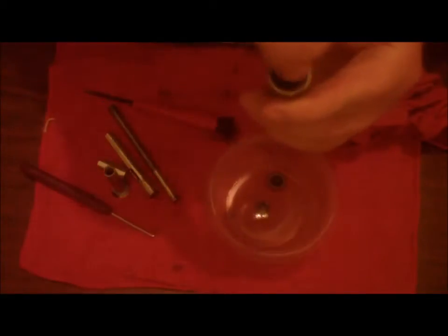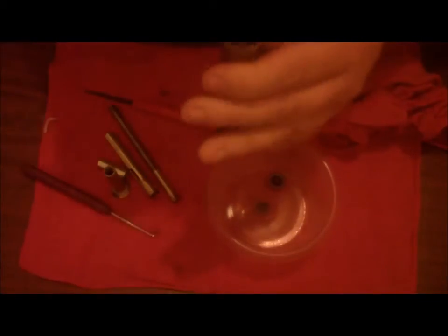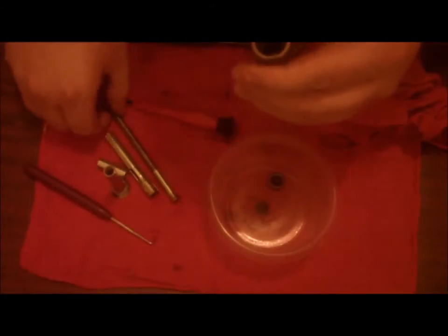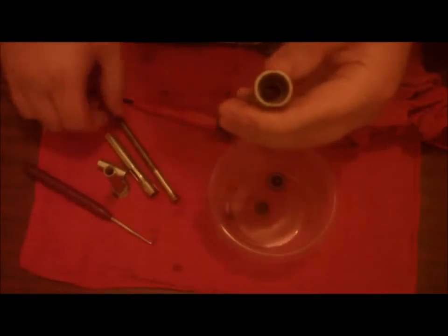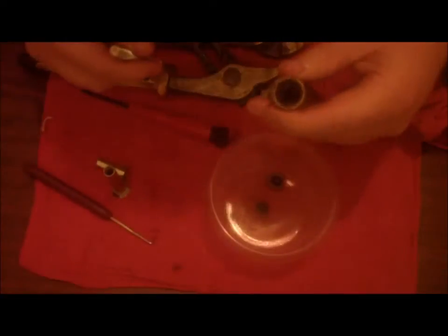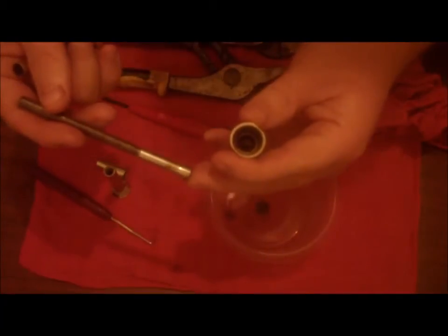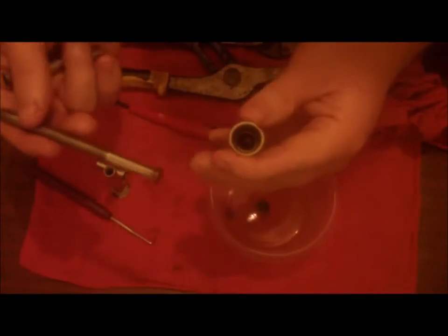I'm going to demonstrate on a stubborn hydraulic roller where the cylinder is stuck. Like I said, you can use compressed air, a bearing puller hook, or some people use a push rod — stick it in there and pop it out. But what I like to do is just go buy a two-dollar, three-eighths anchor bolt. I got my little cylinder, this thing's not coming out, so I'm going to use this puller — this little two-dollar anchor bolt puller, I call it.